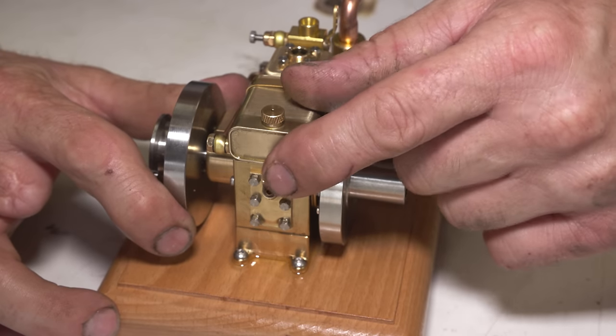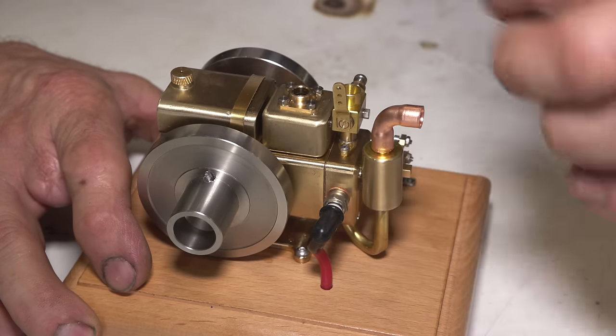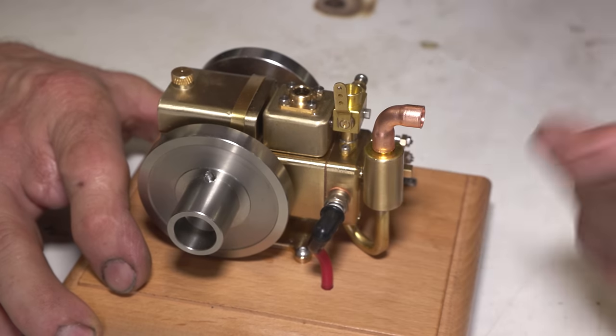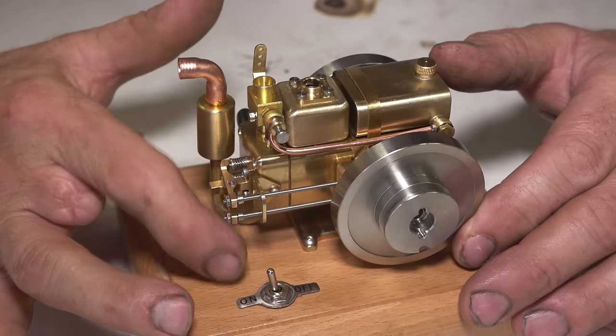This is the crankcase. This is the gas tank. This is the cooling tank. It just transfers heat by contact. You just fill this up with water, and this is the cylinder here. This cylinder heats up that reservoir, and that's how it cools the engine. This is the carburetor, which mixes the air and the fuel, and coming onto the other side, everything is exposed.